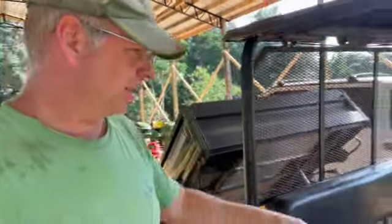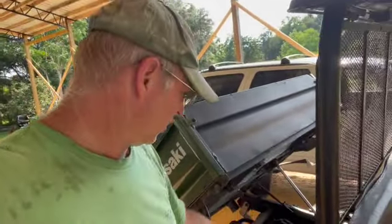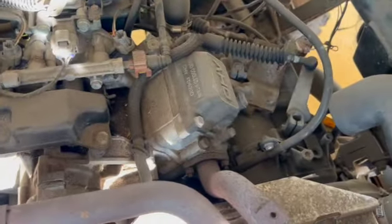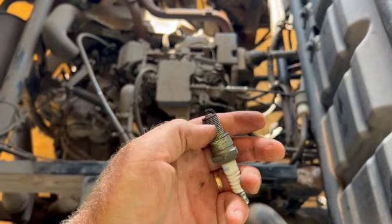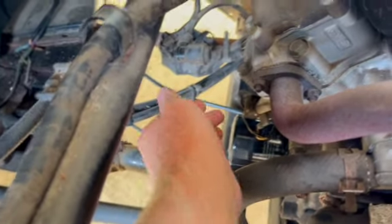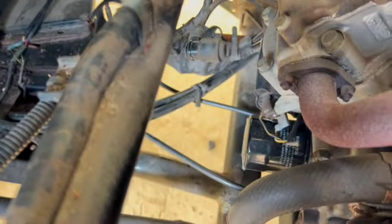It started but I've still got the DFI light on the dashboard. I've got fuel, I've got air, now I need fire — so that means I'm back at the spark plugs and the coils. I pulled the back spark plug cover and the engine died; I started it up again, pulled the front and it actually smoothed out a little bit, so my problem is on this side for spark. The plug looks pretty good and it's gapped properly, so I think I need to look deeper. Next step will be to change the coil, which is this piece right here — I've seen things online where they say that's usually the go-to answer. That means I have to order it, so more delays on getting the mule running.